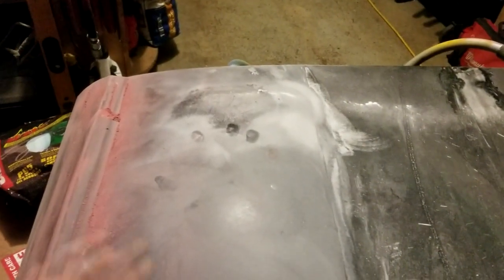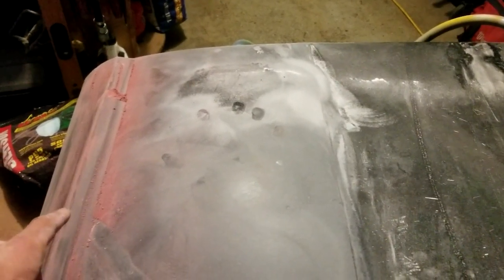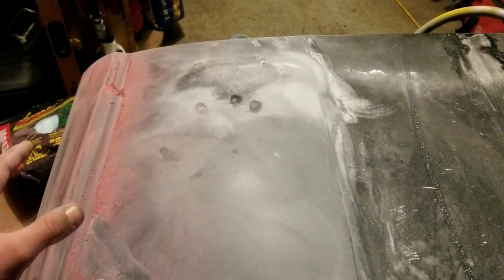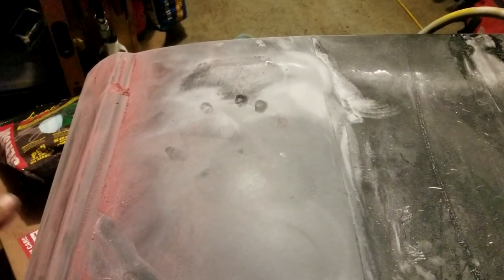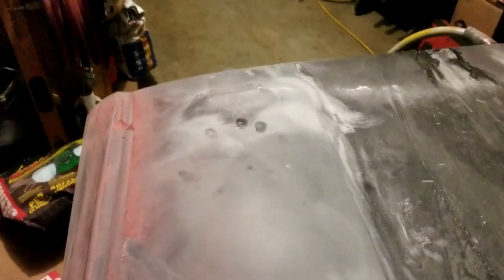like that. And what I'm gonna do now is, as usual, previous time, I'm gonna go lower grit sandpaper. Basically, I did 180, I'll do 320, and then 400 DA, and then maybe 400 wet sand, and then 500 wet sand, 600 wet sand, so on and so forth until I get to the good, good glossy finish.